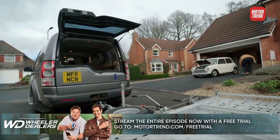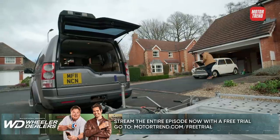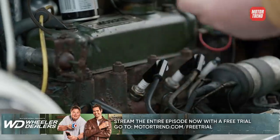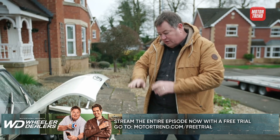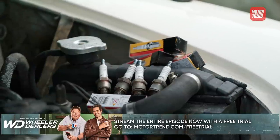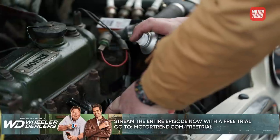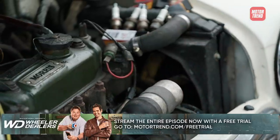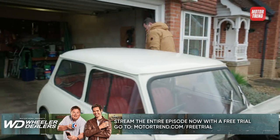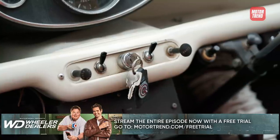The old fuel would have broken down and become contaminated. There may be rust on the pistons, which could damage the block. One of the things I can do is connect the battery up and just jog the engine over to make sure those pistons move freely. To ensure the engine doesn't start up when I turn on the starter motor, I've removed the spark plugs. A squirt of penetrating fluid will help free up any seized pistons. With my fresh battery connected, we're ready to get this engine turned over for the first time in 13 years.